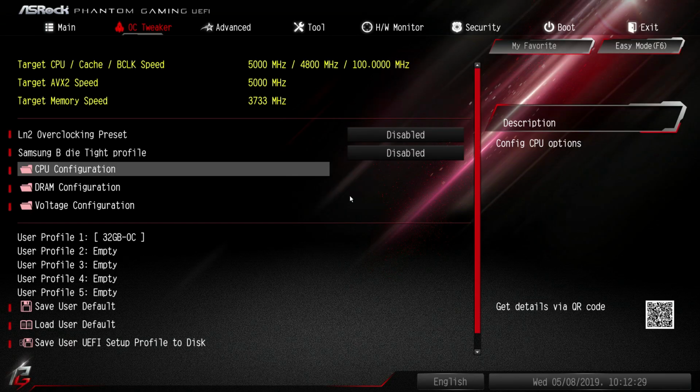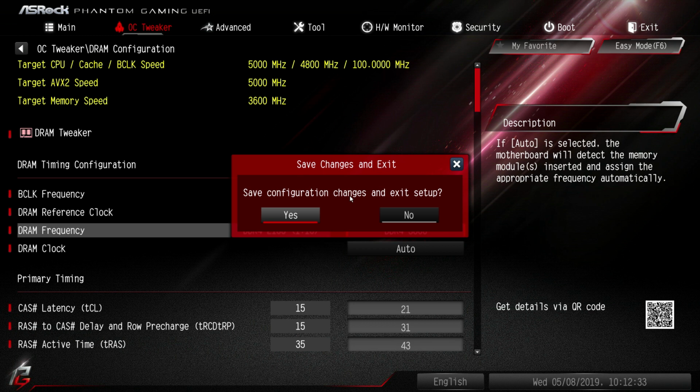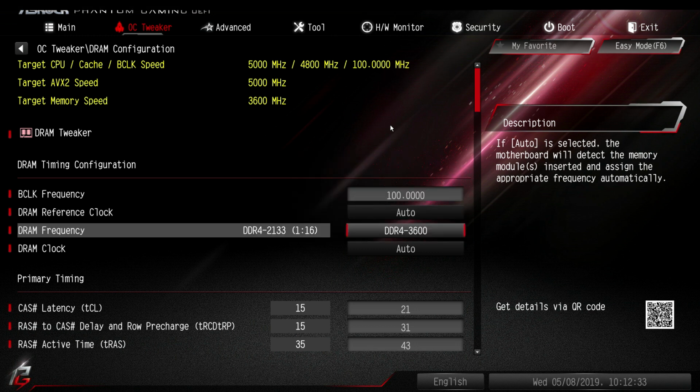Yeah, so now we're going to get the error recovery message, probably. Yeah, we got the error recovery. We're going to go back down to 3600, and hopefully it'll cold boot that, because we did step up the memory frequency slowly. So we might have actually trained the memory controller throughout the process of that. So we'll see if it can cold boot this right now. There.